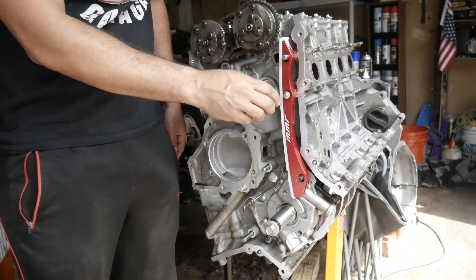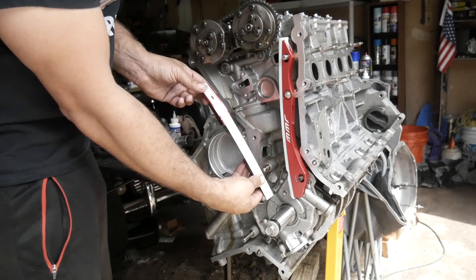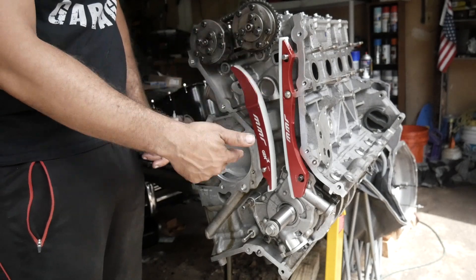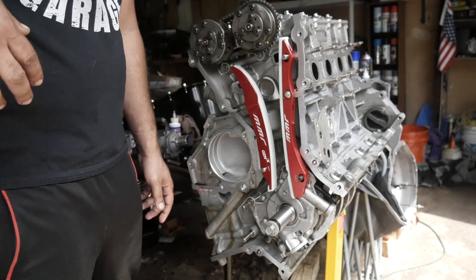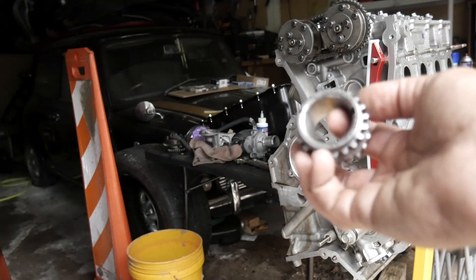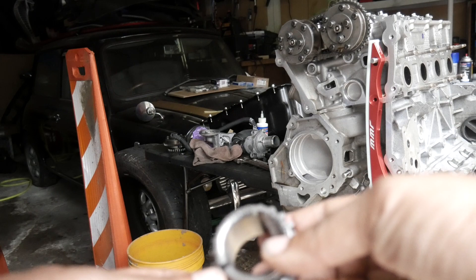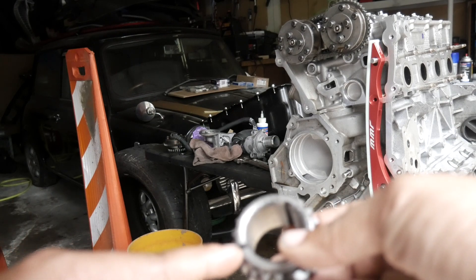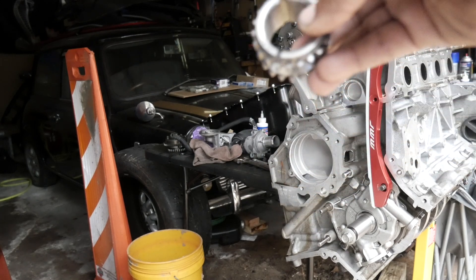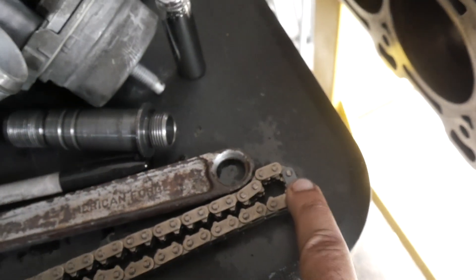Once we get everything in place we'll start getting our torque specs down for everything and get the other guide on here. For the other one it's pretty straightforward — you just go ahead and slide it on and you're good to go. The tensioner is going to go in here, we're going to get the chain on here with the new sprocket as well and get everything buttoned up. This is the old timing chain gear, and this is the new one that we got from Boundary Racing — same people that made our oil pump gears. Much like on the stock one, we have our notch right here that goes on to the crankshaft, and then we have our notch over here to help us set up with our timing. So we're going to go ahead and slide this thing on. Looking at the timing chain, we have one dark link here and one here — these are going to be used to help us with our timing.